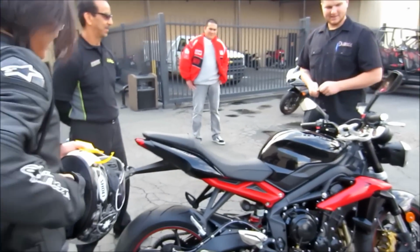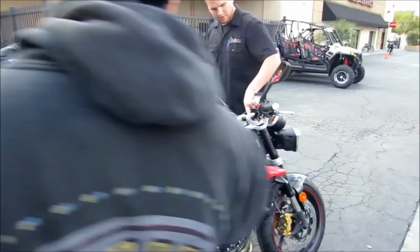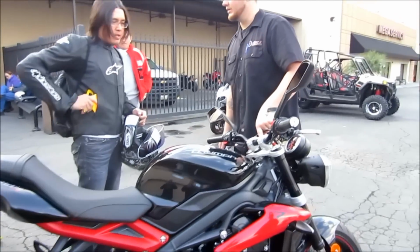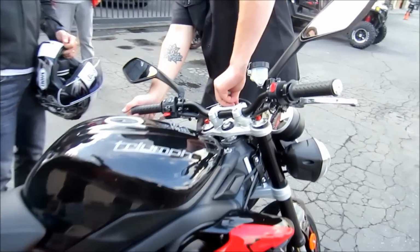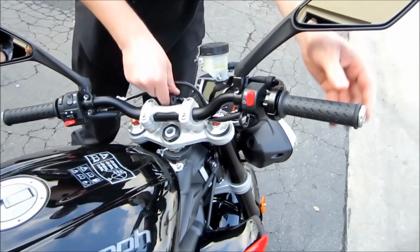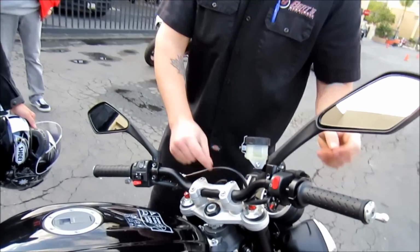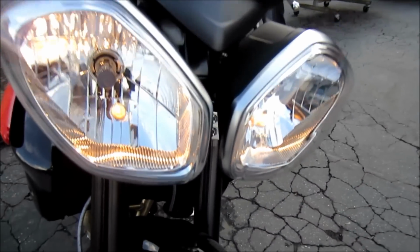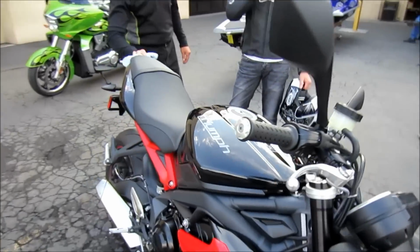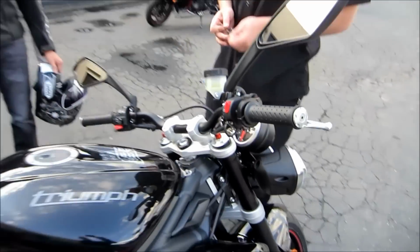Hold the key. Just like your R1, you're going to have a locking position on the handlebars. You're also going to have a parking light position. Be cautious when locking it up, because if you put on the parking light and leave it on for too long, it can wear down the battery. So, lock position, then parking light position. That turns on your front headlights and your rear running light. Say you get a low tire and stop off the side of the freeway, you want to be visible and have the bike locked up, so that's what that's for.